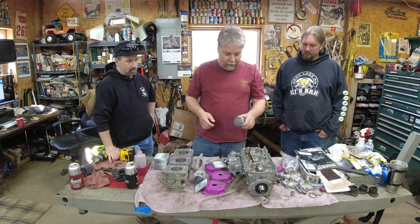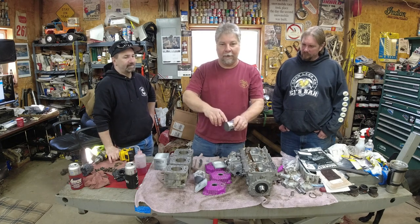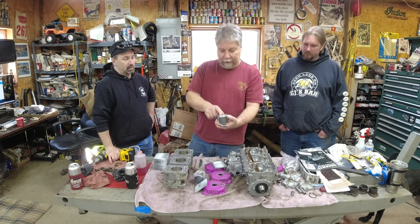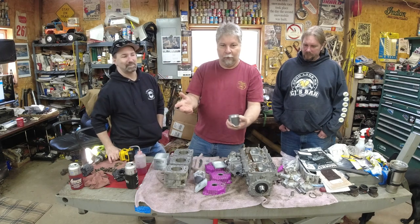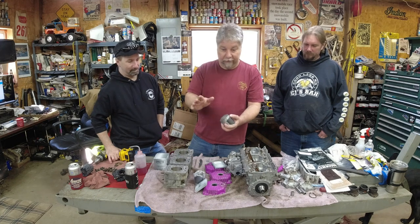two-stroke rings are always pinned. And if you look where the ring ends are, which is where the pins are, there's one right here. That is obviously not going in the exhaust port. There is no intake port on these cylinders. It's smooth all the way down because they're Case Reed motors. So the ring ends are going on the intake side, 100% confirmed.